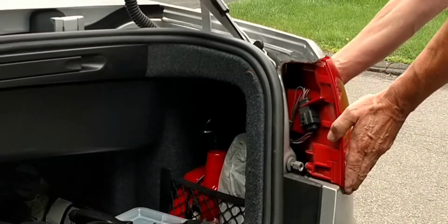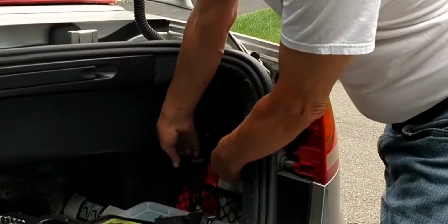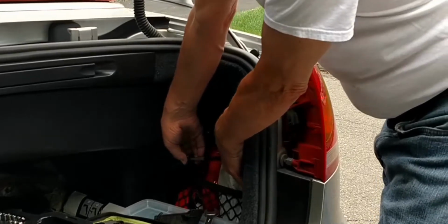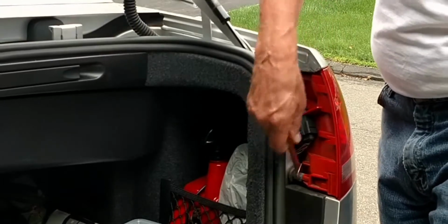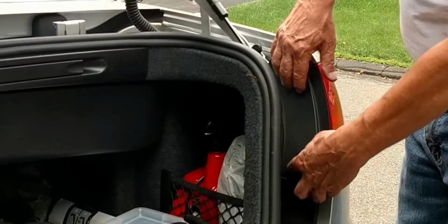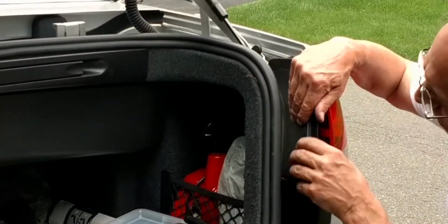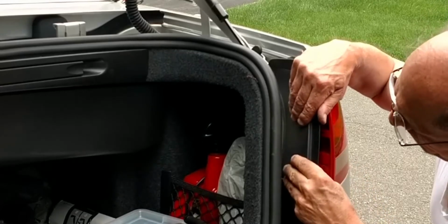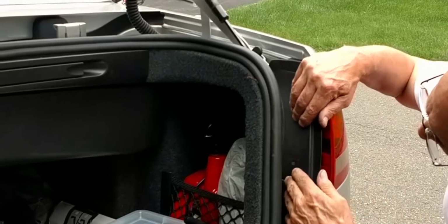Slide the lamp back on from the side. Turn the screw from the inside until tight, and then tighten the nut about a quarter turn to lock it in. Slip the access cover back in on the trunk side and twist to lock. Then line up the side cover with the 2 holes and 2 slots that hold it in. This will take way too much time to get right, and we don't have any good hints to add to help out.